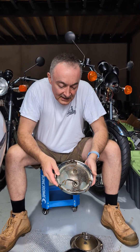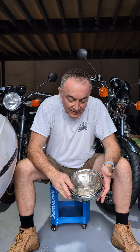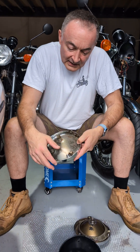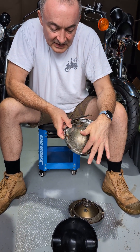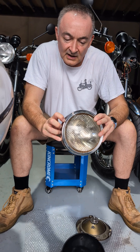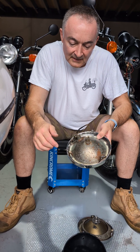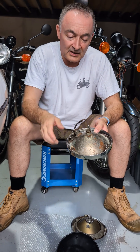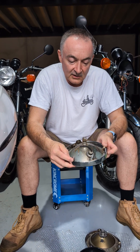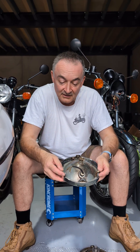Just for clarity here, this headlight assembly is a bit overkill but it's done because it looks sort of beautiful — I think you will agree it does look kind of beautiful. You have an outer chrome trim ring, or a beauty ring if you will, and then an inner zinc housing that holds the actual headlight bulb itself with an adjuster screw to tilt up and down. So: outer trim ring, inner clamp for the headlight assembly, and then the headlight itself mounts into a bucket using this lip which hooks into the top of the housing and is secured at the bottom by two countersunk Phillips screws.